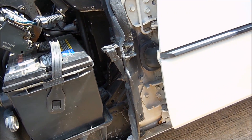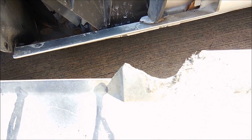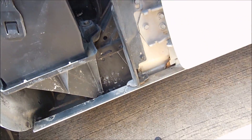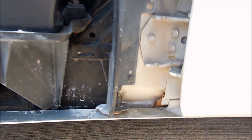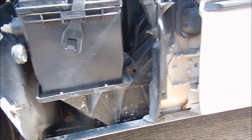On a C4 you have to take out this panel to get the battery out. There's a bolt here, here, here, and one on top. The person who had the car before me didn't know how to remove it properly, so they just ripped it off — it was only being held on by two bolts. I'm hoping to fix that later.